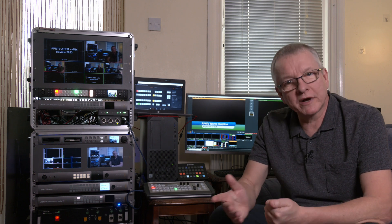I found a little quirk using the DeckLink Duo card. When I first boot up Windows from power down and go into vMix, I turn on the external output and I get no signal. The way I found around that is to restart Windows, go back into vMix, turn it on again and it works absolutely fine — and that's completely repeatable. I don't know if that's a problem with Windows, the DeckLink card, or a driver, but I've not been able to fix it. I have heard of other people having a similar problem too. It's a bit of a pain having to restart Windows every time, but it does sort the problem out 100% of the time.